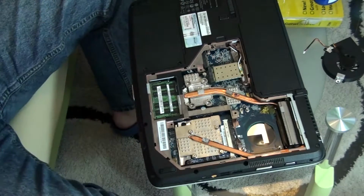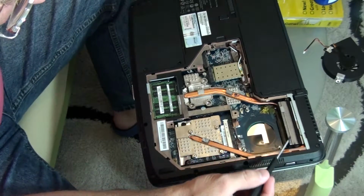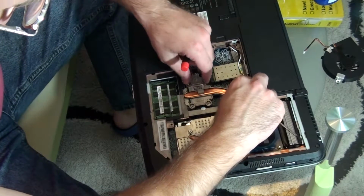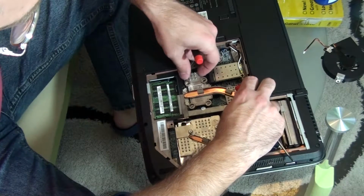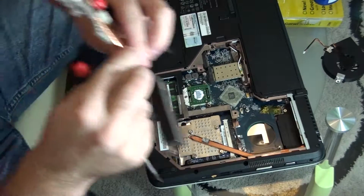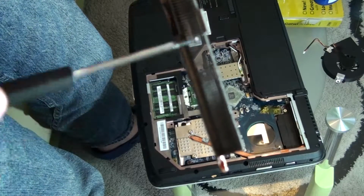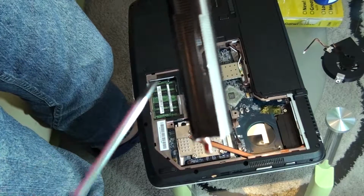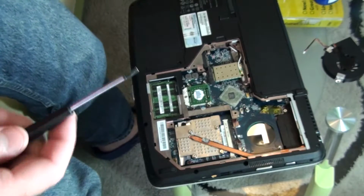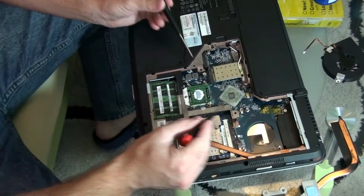Okay, now be very careful and check your laptop, because this area is full of dust, which basically blocks the airflow and causing the chip to overheat. That's that heatsink. This area is blocked by dust, and that caused your lappy to just give up working. The chipset we will have to warm up with hot air is this one.